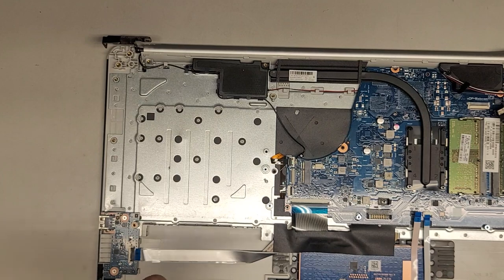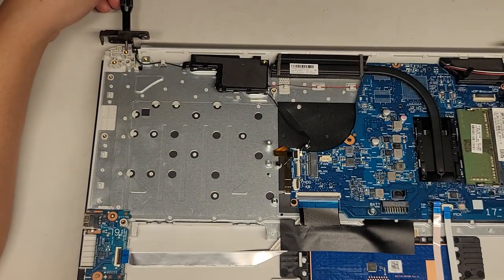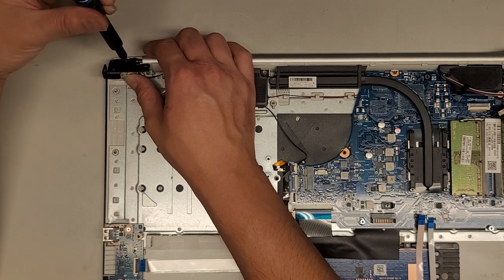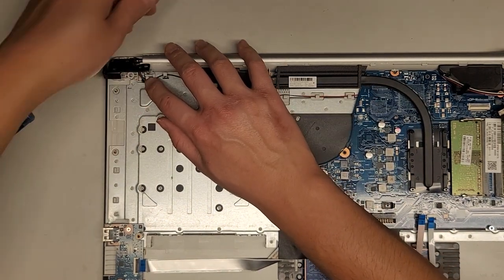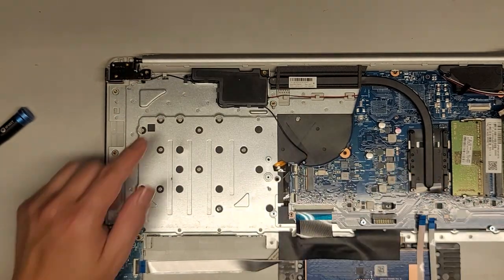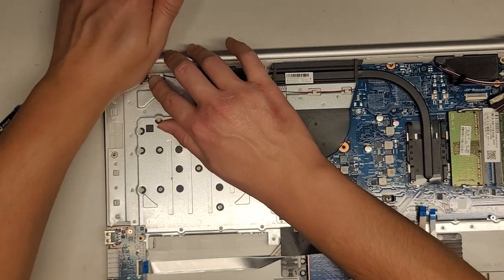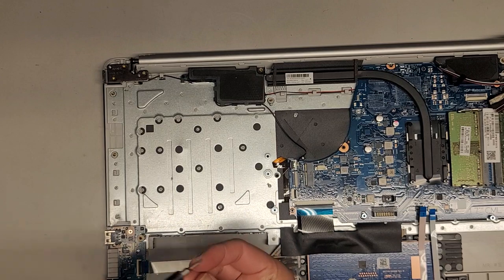One thing you can do — I'm going to switch over to a T8 Torx 8 screwdriver bit and get inside the hinge screw mount, then use that to leverage and turn it to fold it over. Hold the wireless antenna down so it's following the groove and then push it down. Make sure the plastic mounts line up — don't force it down. Adjust the alignment of the base, get it in, and then get the two screws in.